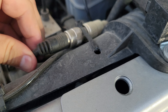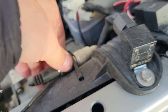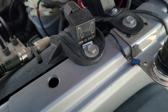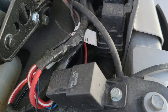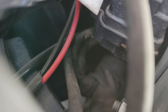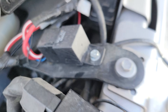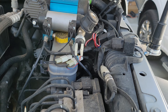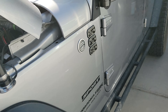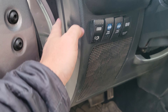This is the connector I've got — the coax then feeds in and I've got it connected right here. I ran a larger piece of coax, RG8X rather than the RG58, down and through. It's really hard to see with the air compressor in here now, but down in there you can access the firewall, which has a grommet that is totally fine and super easy to get stuff in and out of, and that's where it comes through to this side.